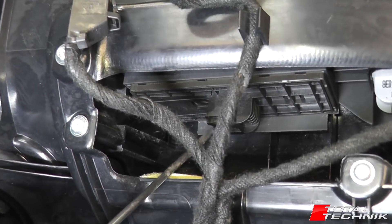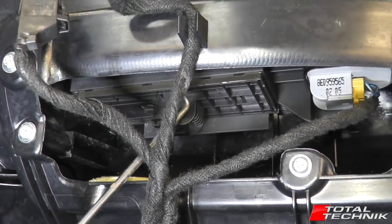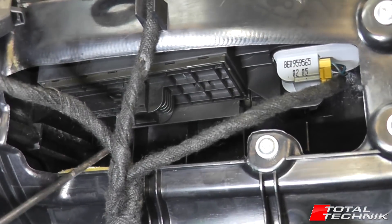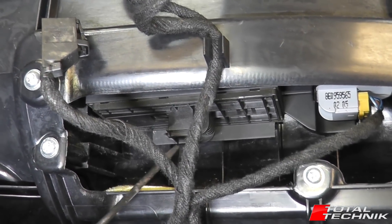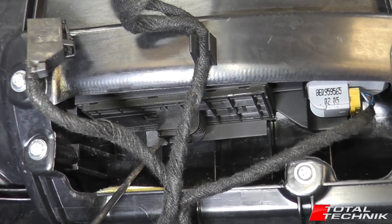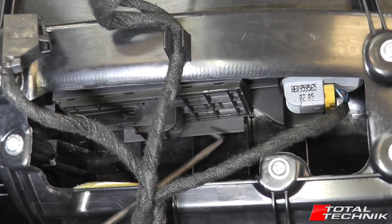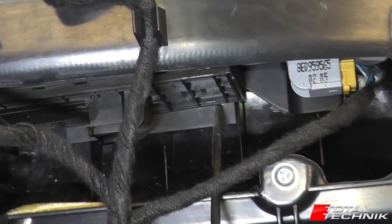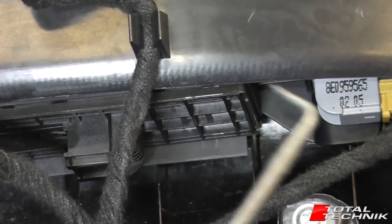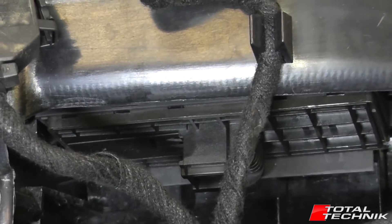The barbs are located in approximately the same place. You can see I just popped one out there. If you look back and see where they're located on the front one and then apply that to the rear, it'll make a little bit of sense. I know that the rear one is going to be somewhere around there in relation to my tool. I just push that in and give a little bit of a twist whilst pushing down — you can see that's actually released there. Both of the rear ones have dropped. That's perfect, so now I can focus on the front two.